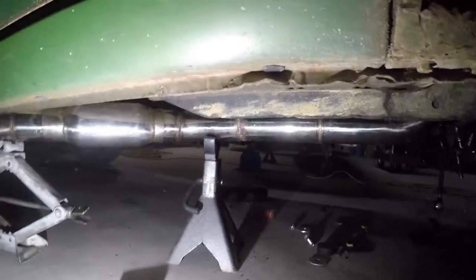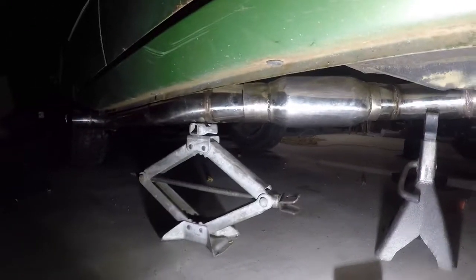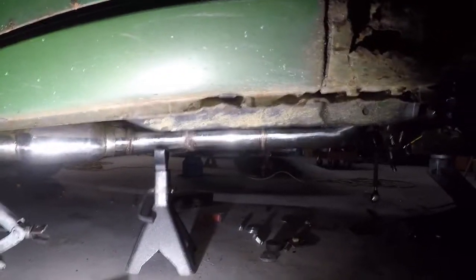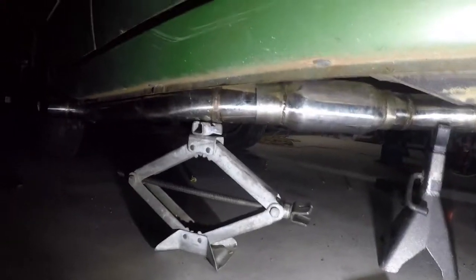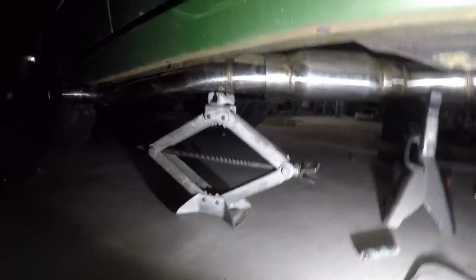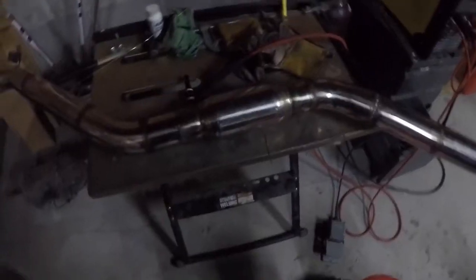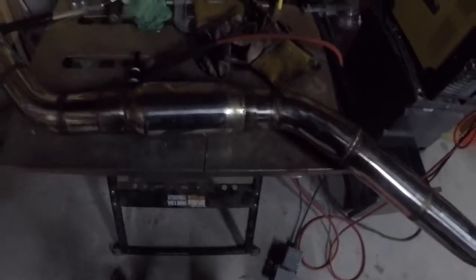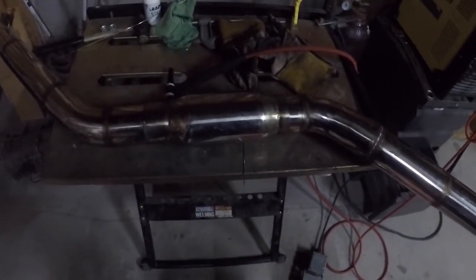We got it in there. We're looking for symmetry — making sure everything is still level and straight to the frame rail. It was never exactly perfect, just a hair off, so it's still around that area, relatively level. It follows along and kicks out, so it looks good. I'm going to get the TIG welder and tack it in place so it doesn't move when I pull it off to weld it. We got it tacked on the car in three places. We'll tack it in that fourth spot to make sure it doesn't pull, and then we'll weld her on up.